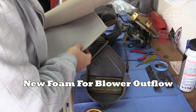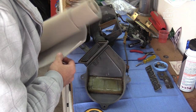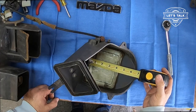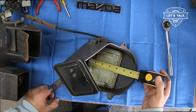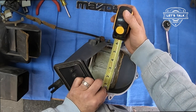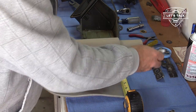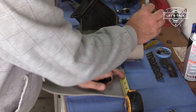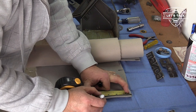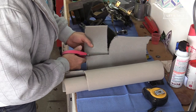Plenty of leftover material from my headliner project. So I'm gonna cut a piece for the heater door flap. Let's measure that. Looking at 4 1/4 by 5 3/8. 5 3/8, 4 1/4. Yeah, so this headliner material is really coming in handy because I use the jute again